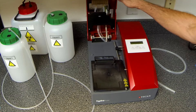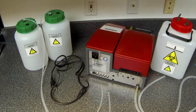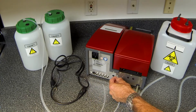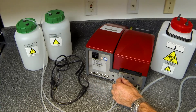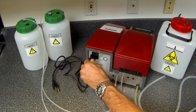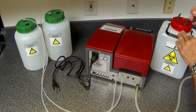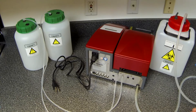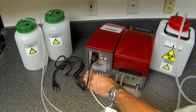You can then set the wash head manifold back down in place. For your connections, run the lines from liquid 1 into the liquid 1 position on the back of the washer, and repeat this step for all other liquid connections. Plug your power in, plug your waste in. And if you want to control the washer from a computer, use the USB cable and run that to the back of the washer as well.